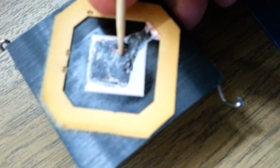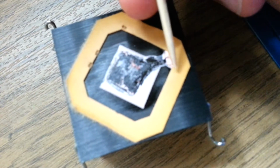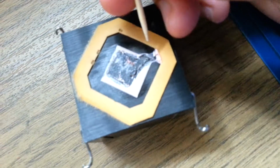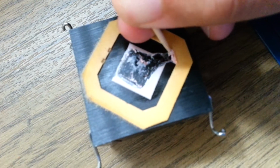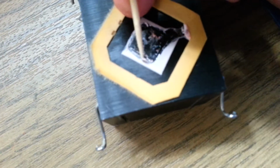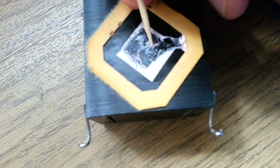Now the next thing to do is to use the same work for the heatsink of the northbridge die. This one is very important, because it holds the heatsink up like this, and it is absorbing the pressure that goes from the die on the northbridge. It's very important not to remove this part, so you have to leave it this way and try cleaning only the area where the die of the northbridge was used.